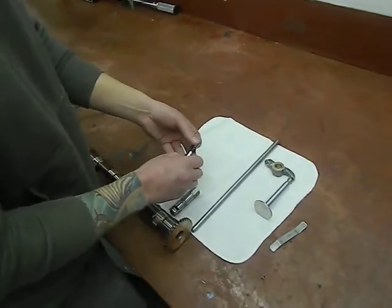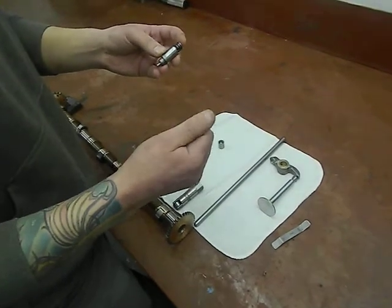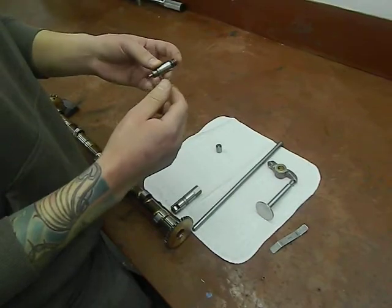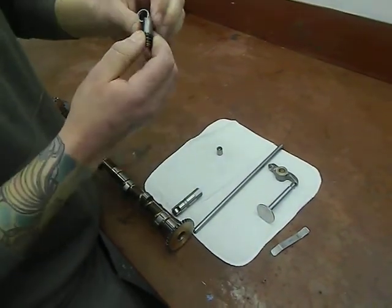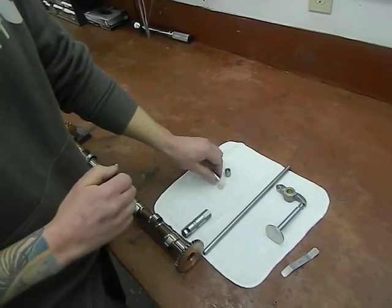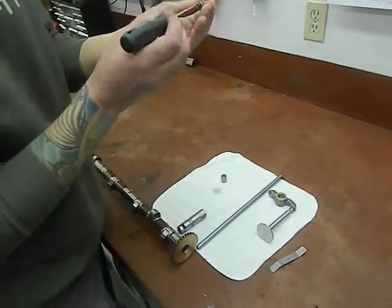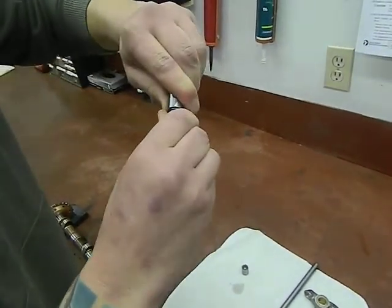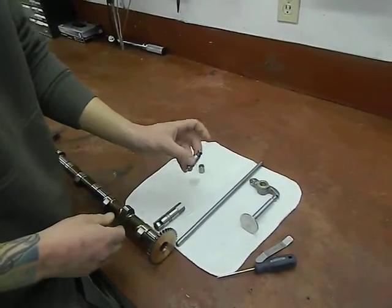To check this — it's called a dry clearance — which means the hydraulic plunger cannot be full of oil. If the engine has been run, this will be full of oil, so you will have to drain it before you check the clearances. Once you get them out, don't use a magnet because you can magnetize them — use a little bit of lock wire. Twist it and just pull, and the oil will be inside there. Once you get that cleaned out, you can actually see it dripping out. Take some compressed air and make sure it's nice and dry. Once you assemble it back together, it won't want to go down — there's a little check valve in there that you push in, and then you'll be able to push it back together. You can actually physically push it down; if there's oil in there, you won't be able to do that. That's the most important part of checking the valve lash — making sure there is no oil inside there.